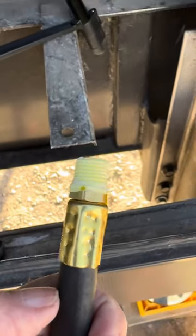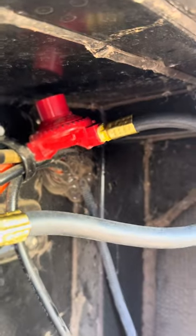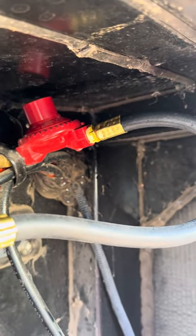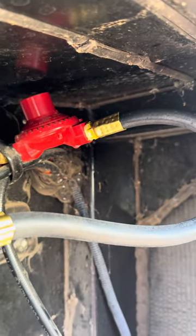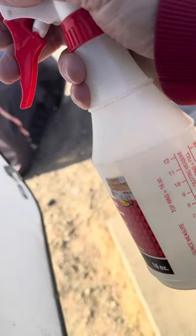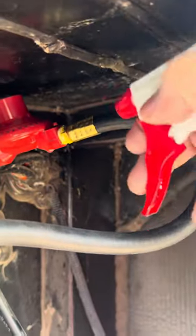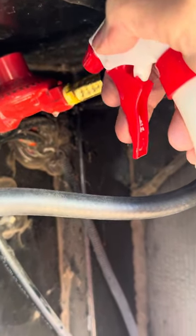I've put on my thread tape. Now I will reinstall the hose. Once everything's all connected and the propane tank is back in, you want to test your connection to make sure that you do not have a propane leak. What you want to use is a bottle of water with a little bit of dish soap in it so that the bubbles will show — spray your fitting to make sure that you have no bubbles.